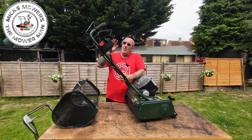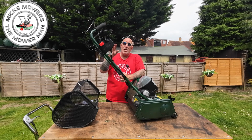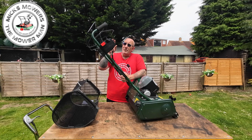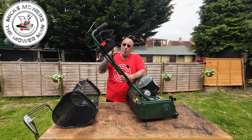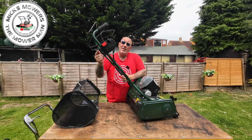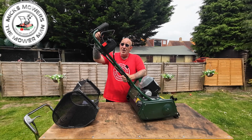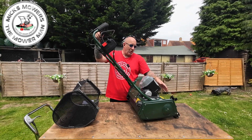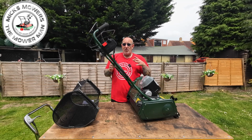The only feature with that is that when you have the speed set on the highest, on number 6, then your drive and your cylinder will be going at the top speed. Now, as you bring that variable speed setting down to say number 3, that will not only decrease your walking pace on your drive system, but it will actually slow down your cylinder as well. So just bear that in mind with regards to your clip rate.